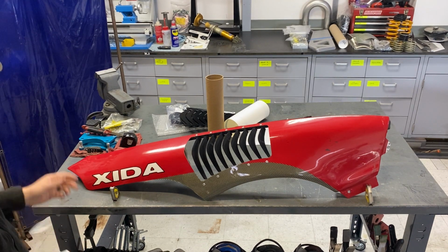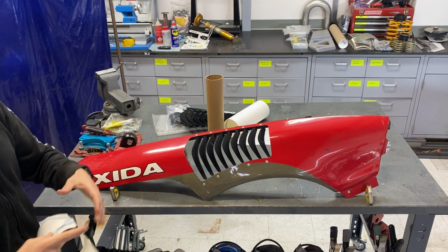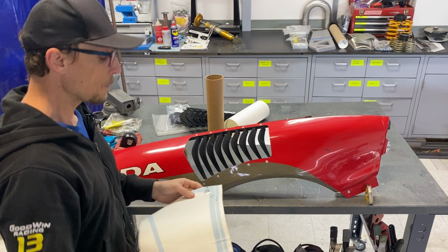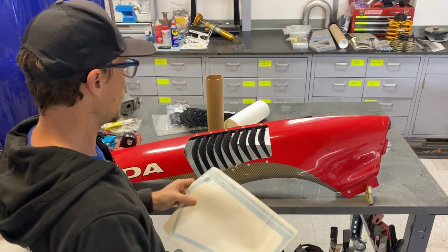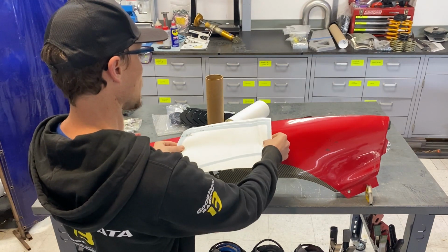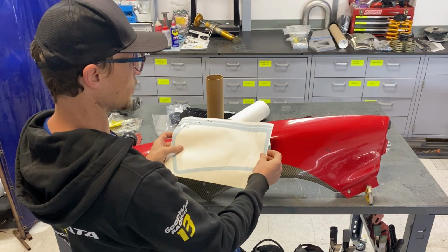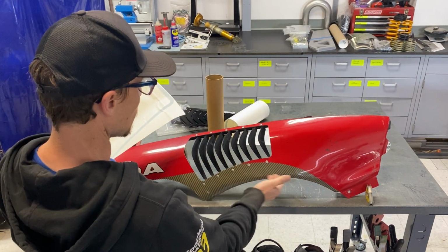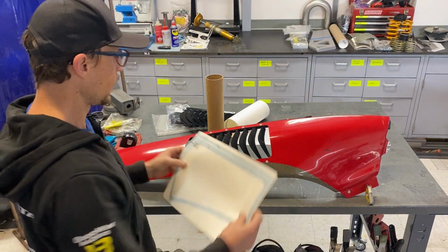The NB fender has a similar point at the back corner of it, and you'll measure 19 inches as the template says. So with that, placement of this template should be pretty easy. That tells you exactly how to align it this way, gives you the height that way, and gives you the placement this way. And that really just locks in the positioning. This curve will line up nicely with the wheel arch.